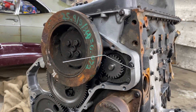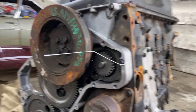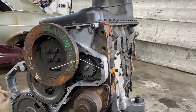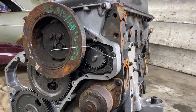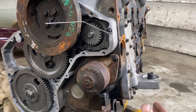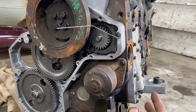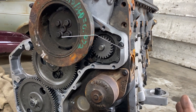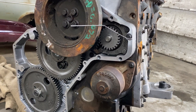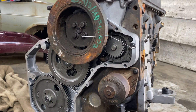Next up on the engine is injection pump timing. There are a bunch of different methods — some use a dial indicator, some use air for spill port timing. I use a balancer and a hunk of welding rod. It's not the most accurate, but this whole mechanical engine isn't very accurate either. There are so many factors: injector washer thickness, head gasket thickness, piston bowl shape, injector pop-off pressure. So you just set it, try it out — if it sounds too rattly or is low on low-end power, pull a couple degrees out; if it falls off up top, add a couple more degrees.